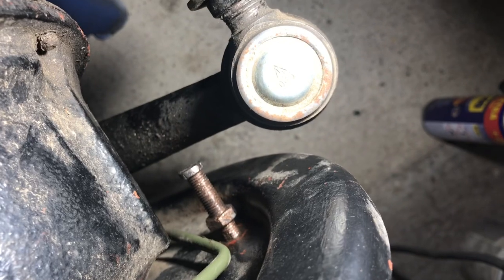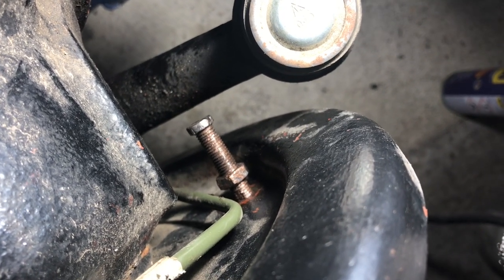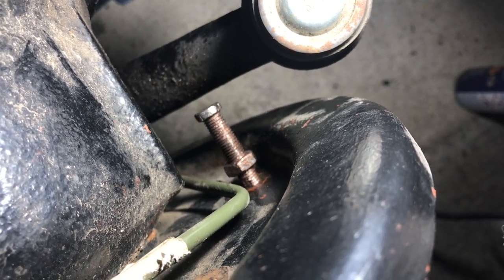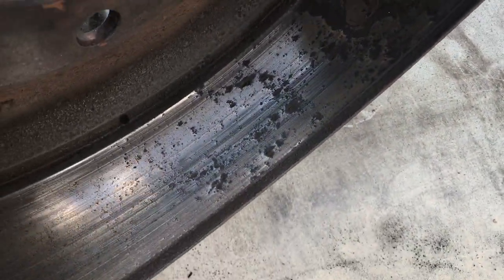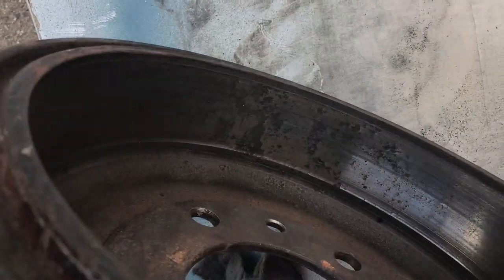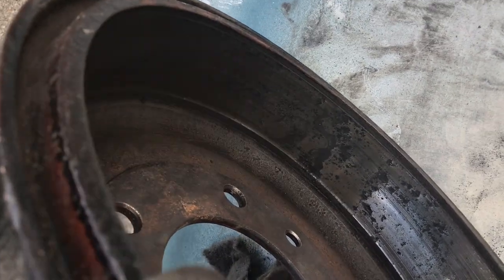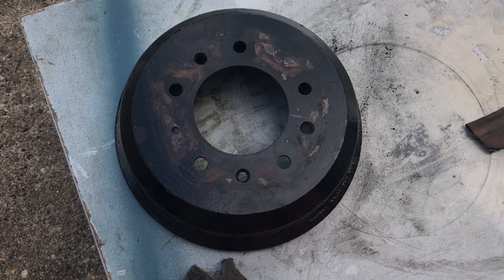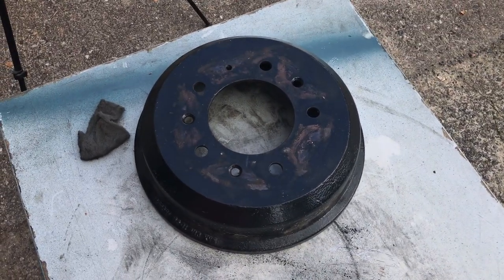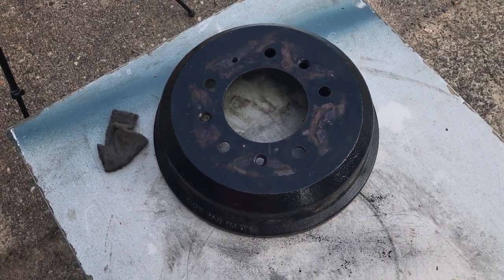I've got that camber adjuster nut and bolt out. The thread's still there — on the inside it's a bit eaten away where it's rusted, but it's still totally usable. Just like I did the other side, I'm going to clean that up and put it all back in with a smidgen of copper grease. I've been cleaning that adjuster up on the wire wheel and coated it in a little bit of copper grease, so everything is now working freely. I'm going to adjust the shoes now. Looking at that drum on the inside, I've just cleaned it up a little bit. You can see from when it was sitting — probably with that part of the drum down for all those years — moisture collected in there and started to rust it. So I'm going to do a bit of wet and dry, clean it up, and just reuse it. Ideally I'd buy a set of new front drums at some point — Mintex seem to be pretty good.